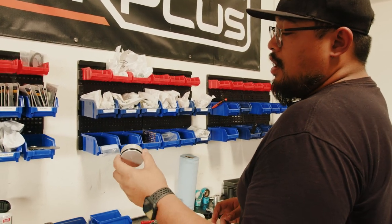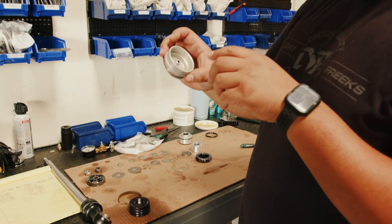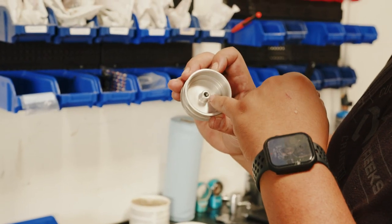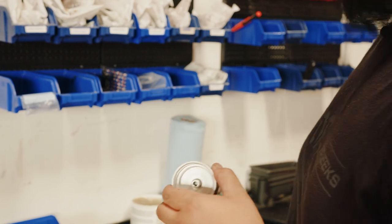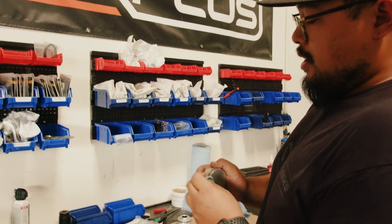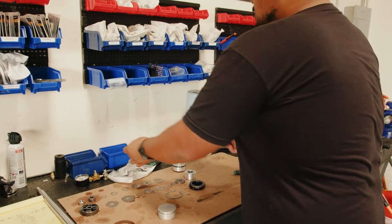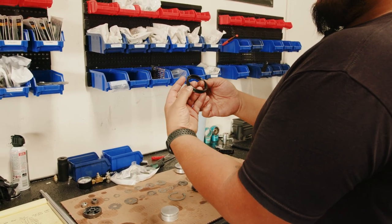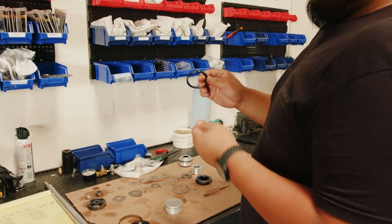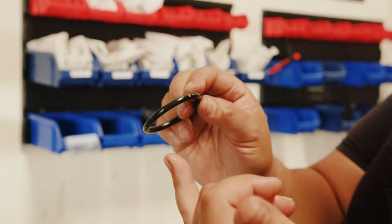With the seal head done, change out the o-ring in the IFP — just pinch the o-ring and slide that off. This is the threaded portion of the IFP, which is a quarter-20 thread. If you don't have an IFP tool, just take a long piece of quarter-20 all-thread, screw that in and pull the IFP out. Clean off the o-ring groove, match up the new o-ring to make sure it's the right size. Take some assembly grease — a neat little trick: new o-rings will have some kind of a mark on them so you can tell they're new — slide that onto your IFP.